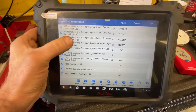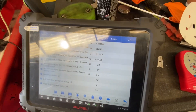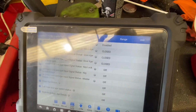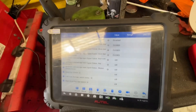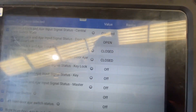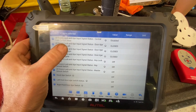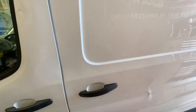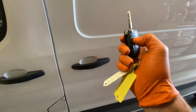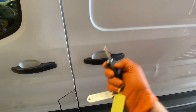I have been looking at door lock positions - that PID there, the second one down, is for our side door. I'm pressing the button and we can see our door position is changing. It's stated as left rear but it is actually the side door on the left hand side. So by cleaning those pins I have in theory fixed the issue with the door locking and unlocking.